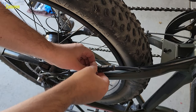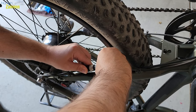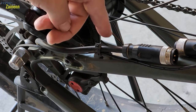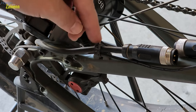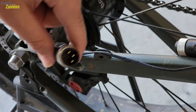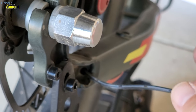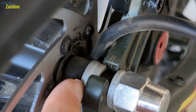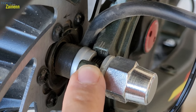First step to removing the tire, you have to separate these components. I have to get rid of this little zip tie right here, so I'm gonna cut that — be very careful not to cut any cords. Then lift this to the side. Next I'm gonna take this wire out of the way, loosen this up, and I have to pay attention to this washer right here. It has to go in the same position when I'm putting this tire back on.